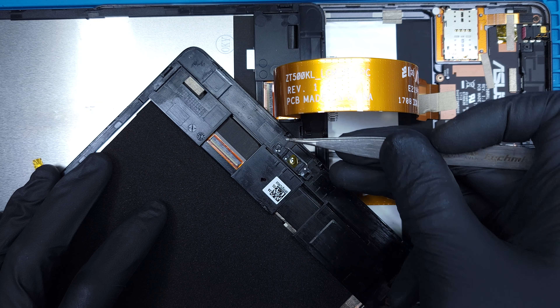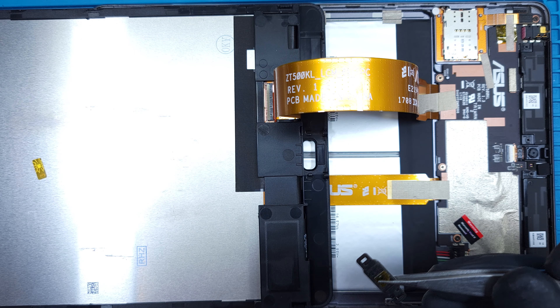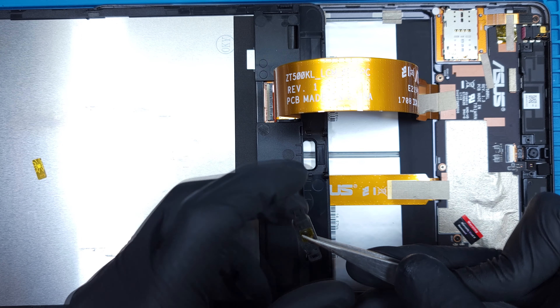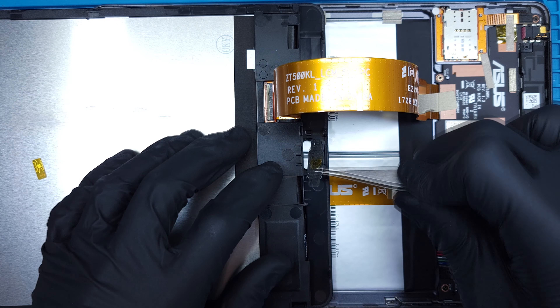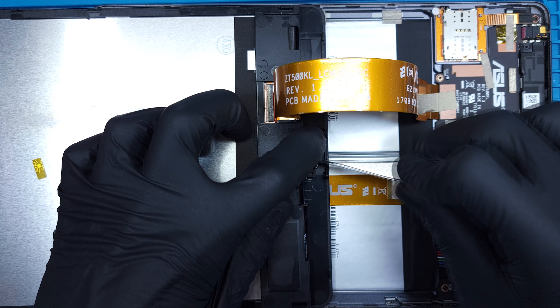As fancy and glass-like as the home button looks from the front, the back reveals that it's just a plastic piece with no functionality, held in by two rubber dampeners. It can be easily pulled off the old screen and seated into the new display with the two plastic hooks holding the rubber dampeners on either side.